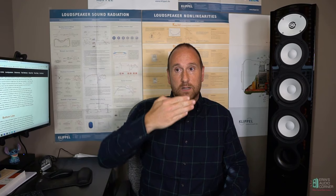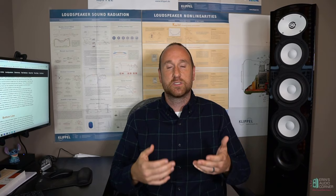But I don't think that's a bad thing. It's just something that some people like. Sometimes that can be a little bit gimmicky too. When you start talking about soundstage effects, you kind of got to watch that a little bit. But as far as depth goes, that's where that is. Now height, no issues there. It was really neat too, because as things transition from side to side, you could actually tell that the height was moving in small increments, which sometimes will be a phase issue between a mid-range and a tweeter, or a mid-bass and a mid-range.